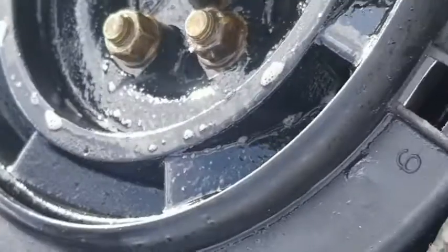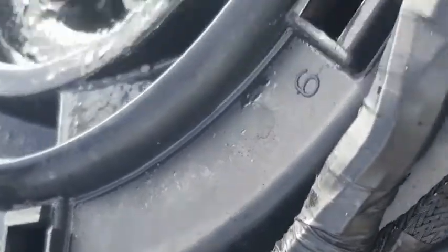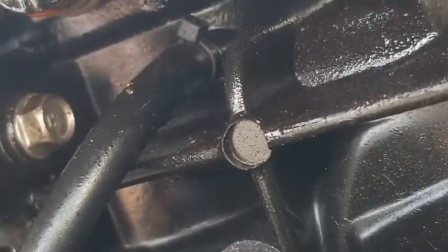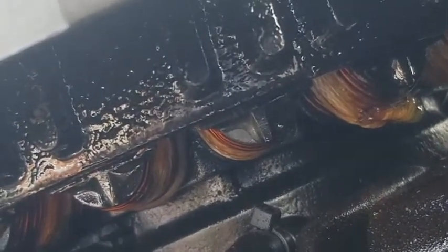We're back at it — got the flywheel mounted back on the engine. Since we're using the same flywheel, hopefully there's no need to adjust the timing; it should be in spec. While you have the flywheel off, you may want to wire-brush any corrosion you see and then spray it down with Corrosion X or Amsoil LHD Metal Protect — works great, leaves a nice thin anti-corrosive film. Two coats of epoxy and a top coat of engine paint should protect it better than what the factory did.